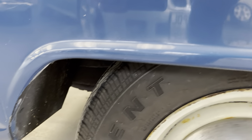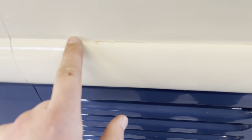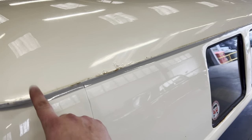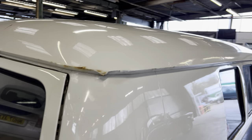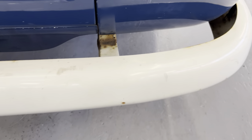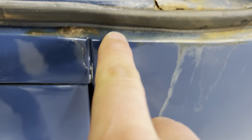This rear arch is again nice and clean and solid. Down this seam, which can quite often be a problem, it all looks nice and clean as well. There is a small bit of cracking on the body line, a little bit of surface rust around that window, but it is watertight — nothing's coming through. A little bit on the gutter, which is a common area on early VW Type 2s. Looking down that side you can see it's nice and straight on the rear. A little bit of rust on the bracket for the bumper and a couple of cracks, plus a little bit of residue where stuff's been left on the paint.